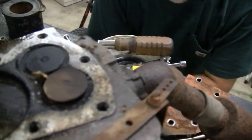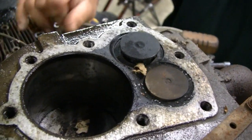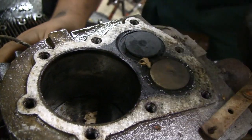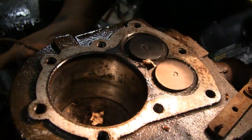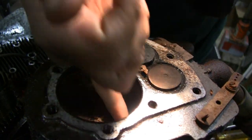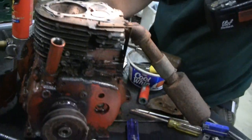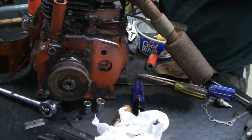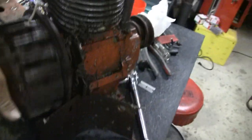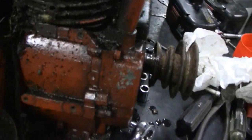Alright, the valves look good, the piston looks good. Spin it down, let's see the cylinder. Shine a light in there, buddy. Yeah, I don't see any scoring. Not much wear either — isn't that something? The guy said this was a snowblower engine, the rest of it went to pieces and he just took the engine off and put it in the corner. I guess we'll try and take that pulley off next and then clean up the bird's nest there and the flywheel. We'll take the flywheel off, see what's behind it — probably all kinds of crud.